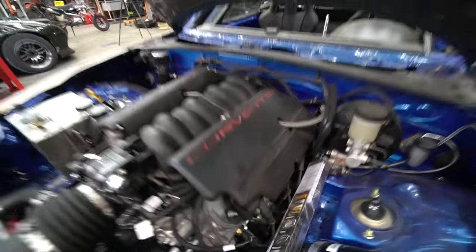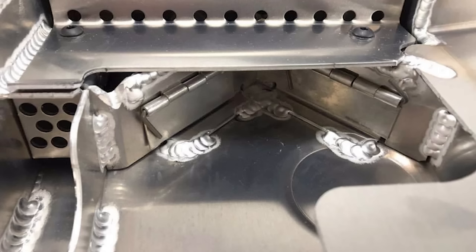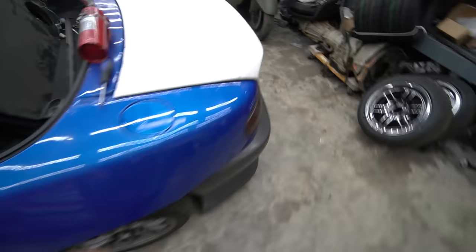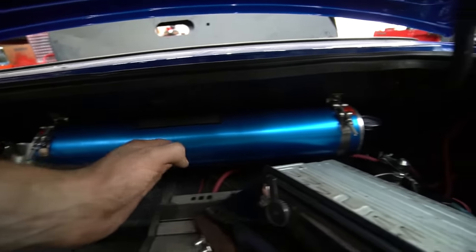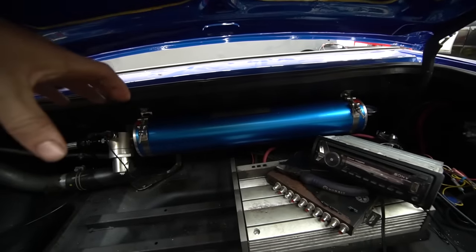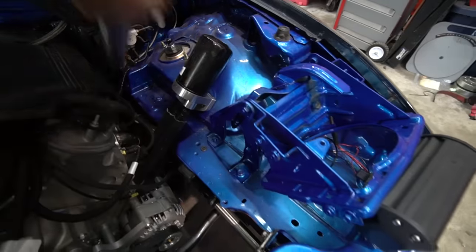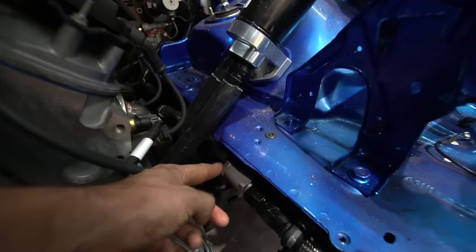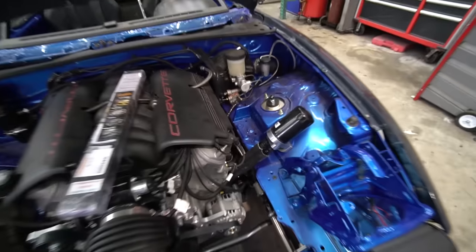The simplest remedy is a good oil pan. On my roommate Ben's car, he has a baffled pan — within the pan there are little trap door baffles that allow oil into the sump area where the pickup tube is, but not out of it, so as the oil sloshes around, it collects in the center. The other big thing, something I think is a necessity if you're going to drift your car, is an AccuSump. It's a pressurized cylinder with a piston — as it fills with oil, the piston compresses air and becomes pressurized. If your engine drops below a certain oil pressure, it supplies the engine with that stored oil. A check valve allows the AccuSump to feed directly into the engine rather than going through the cooler. That line runs back to the AccuSump tank.